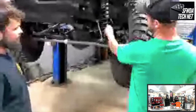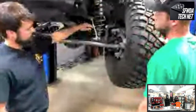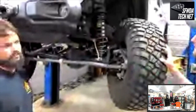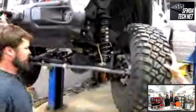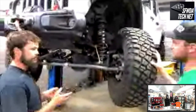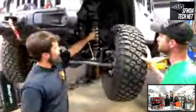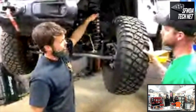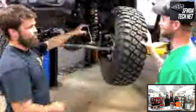The soft bump stop simply limits upward flex and takes the stock dimension and moves it up to compensate for bigger tires. If you want more flex, the true limit is really determined by shock length — you want a medium-length shock to keep driveline angles correct and not overextend U-joints. If the shock is too long, and you're running a progressive coil spring, the spring can actually sag down and fall out. If a spring drops out at speed, you're sitting on the bump stop with no suspension — a bad situation.